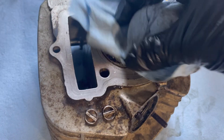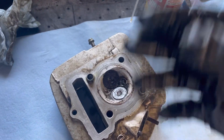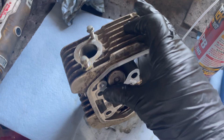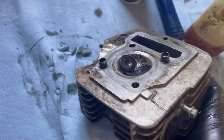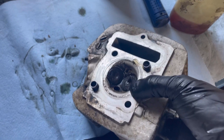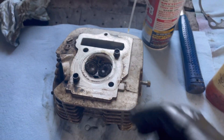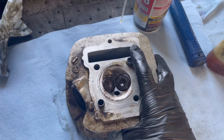Once you've got that and you keep working it in and tap it and stuff like that, they're going to want to open, and it actually will open. Have a finger on the valve spring, flip it over, and find a good way where you can look at it and press it at the same time, and you're going to see this valve open. I'm going to see if I can show you guys.